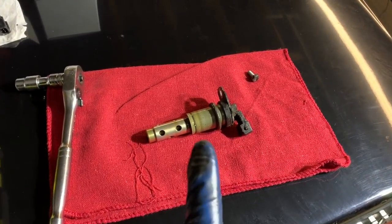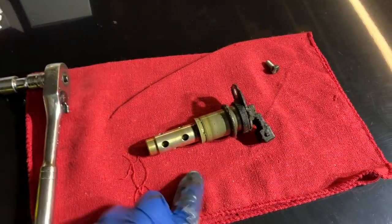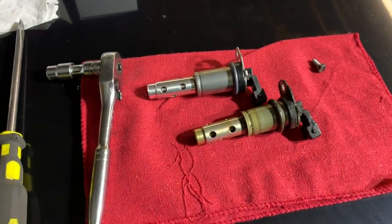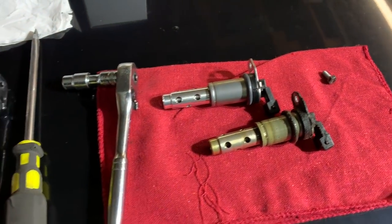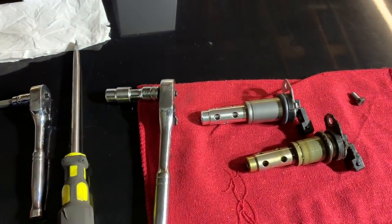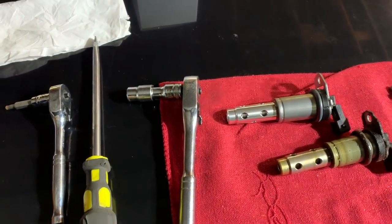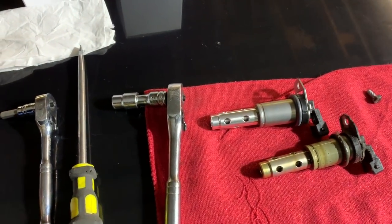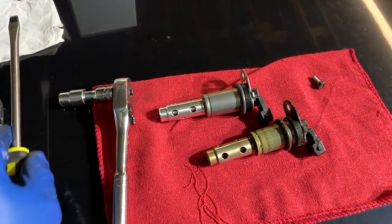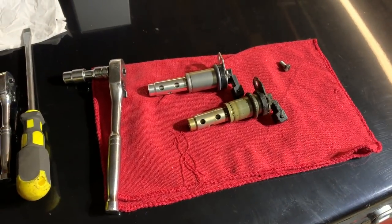With just a moment or two's worth of work I have the top Vanos solenoid pulled out. This is the old one I just removed from the engine, and this is a brand new one — you can see this one is considerably nastier than the new one. You might find it a little easier to get to that 10 millimeter bolt if you use a short extension, as there's a bit of a lip on the valve cover. You also might find that using that flathead screwdriver will help you pop the connector off the end of the solenoid.